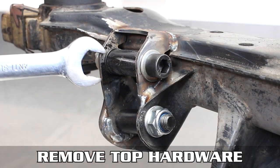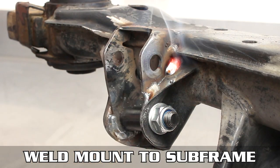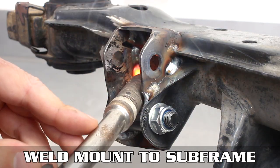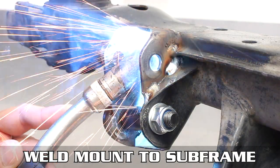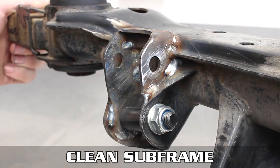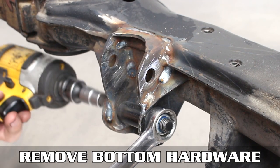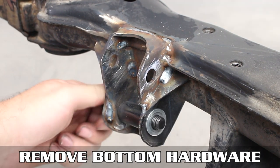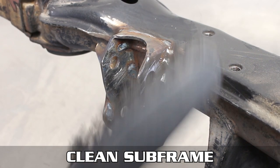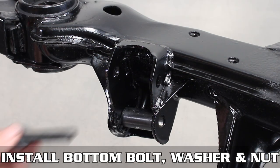Now remove the top hardware as shown, then remove the insert. Weld the remaining parts of the bracket — and we left clearance space for the washer and nut, so don't weld it all the way. Fill any places that need dimes stacked, then clean any spatter or slag up. Pop the RLCA back in and make sure you still have the full range of movement. If you're good to go, remove the bottom hardware with the insert. Finish cleaning any slag or spatter off, wipe it down, then use your favorite color of paint to coat that sucker to prevent rust and promote good looks.